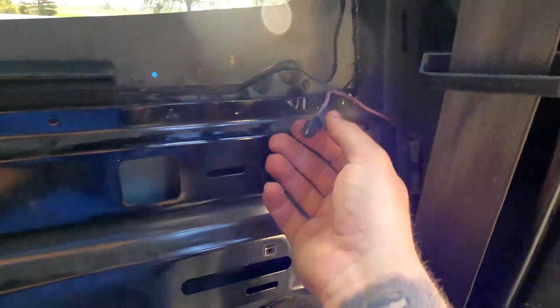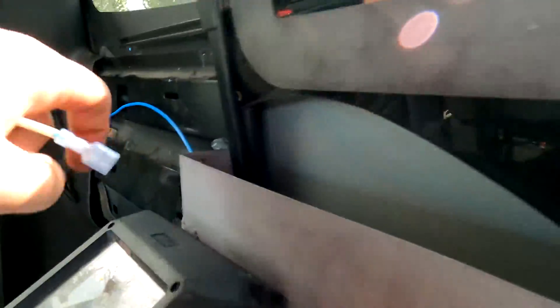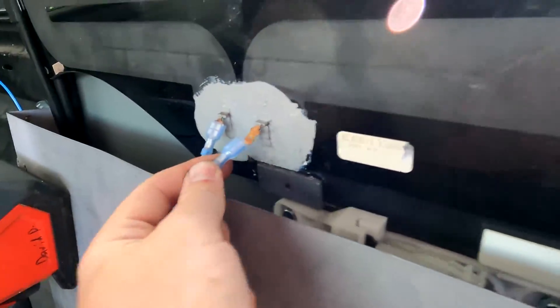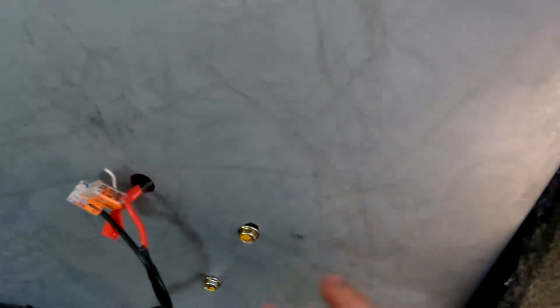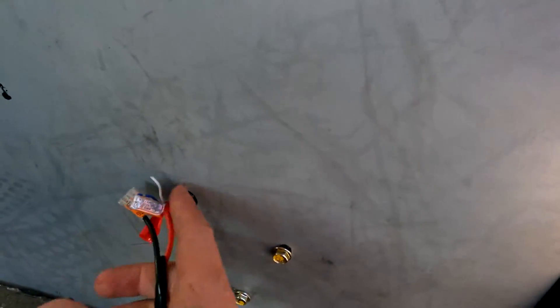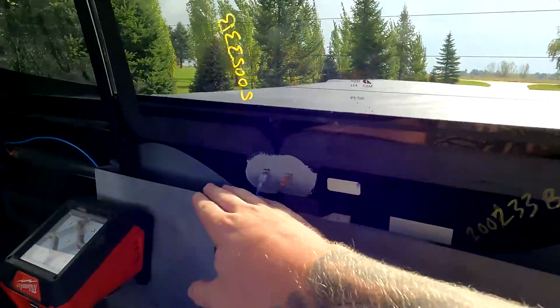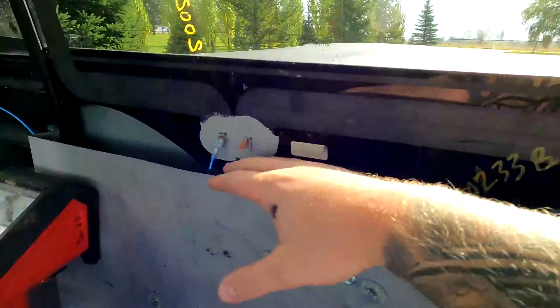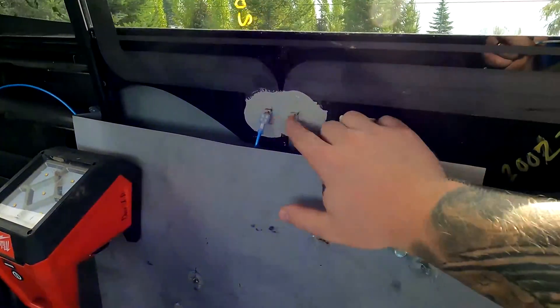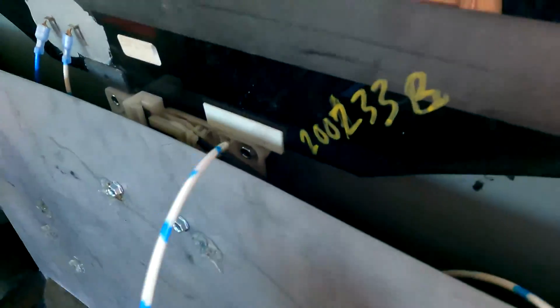You have your defrost hot wire, and then one wire that goes straight to the ground on the side of the cab. You run it through here and you have a disconnect that simply slides over. This is your positive 12-volt voltage coming through. I'm going to cut this, splice it together, and run it through the same hole I already have wires going through. The biggest thing to understand is that this window drops down, so you can't just run straight across — you need to leave enough slack in the wire so that when it drops, the disconnect doesn't pull out or rip the defrost connector.